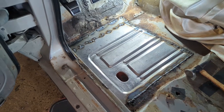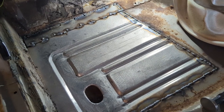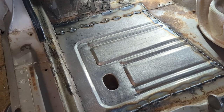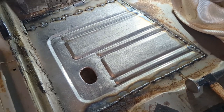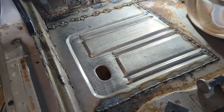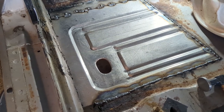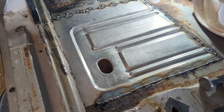There she is — she's welded in, as much as I can weld it from the top right now. I have to weld the bottom yet. I put some plug weld holes along there and gave it a couple extra stitches over there just to make it stronger. I have a lot of grinding to do obviously, but that's it — one floor pan for this old buggy. The other side only needs a couple little patches here and there, so it won't take a full floor pan. This side will be solid.